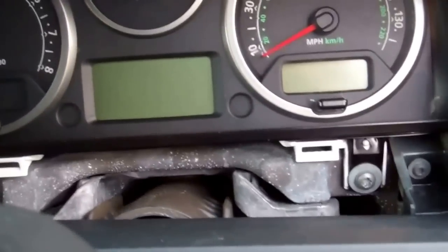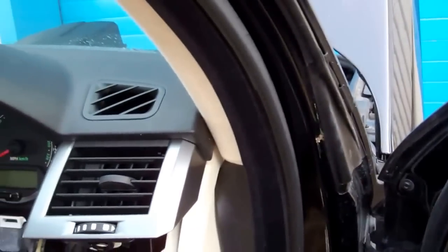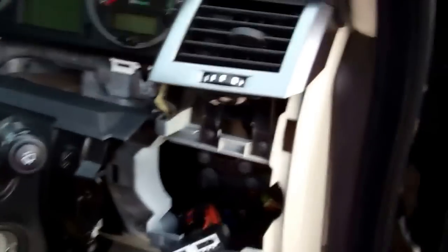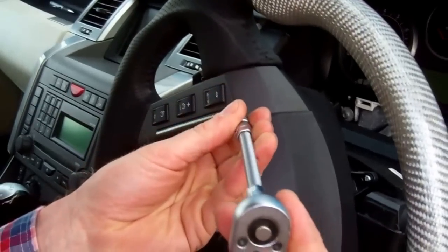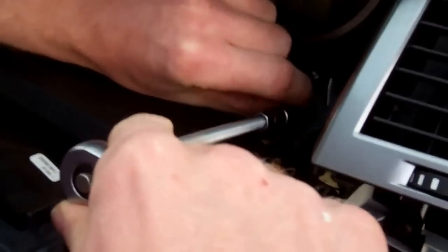In there you'll see this little - if you hook that in under there it'll sit there quite happily. So we've got this frame that sits around the steering column. By removing that top cowl we've enabled that to come down, and then we can access - if I look from the front here - we're going to access these two screws here. Tom's managed with his extensive tool collection - we've got this little wobbly drive here and that gives you just a little bit of a better angle, reaching over the top to get in there.